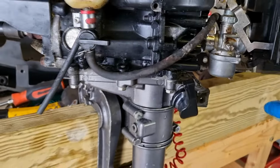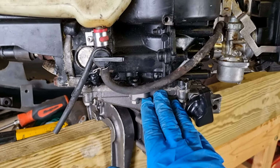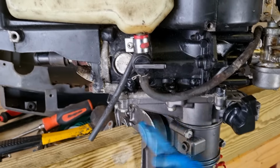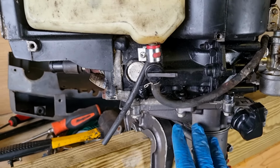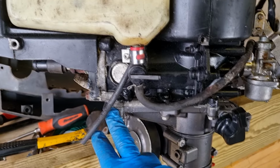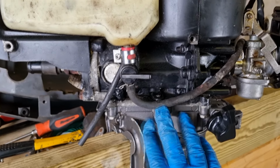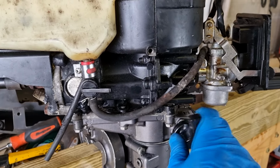Together. That was nice and easy. I've got the 6 bolts in there, and the gaskets in there. I remember when tightening up to do them diagonally across, and don't use power tools. I didn't use a power tool, just do it all by hand. If you use power tools, you can risk stripping the thread or just generally damaging it. It doesn't need that, it's just all by hand. So that's all done. I'm happy with that. The lever's still working.